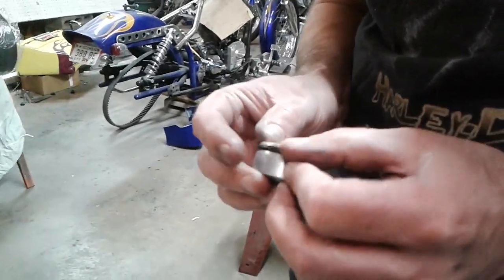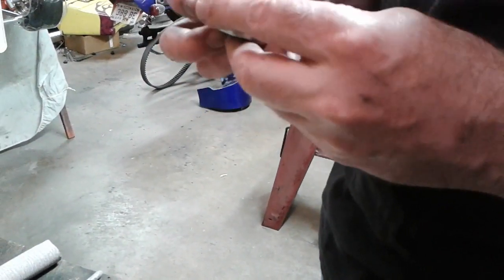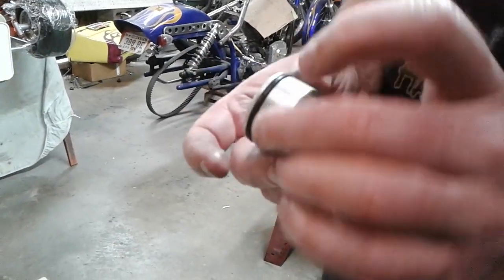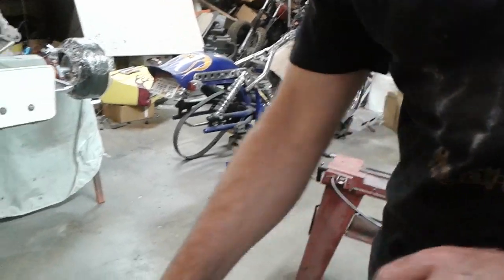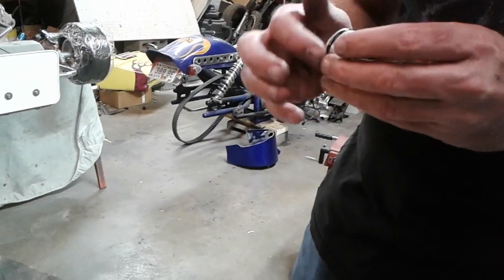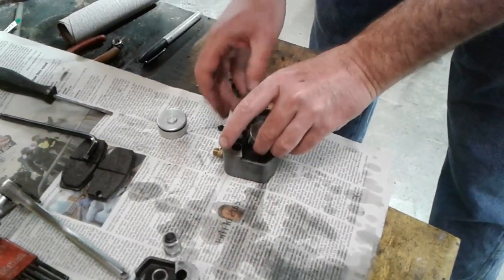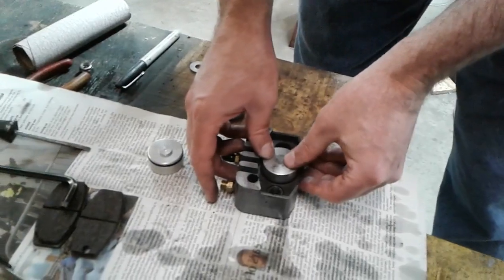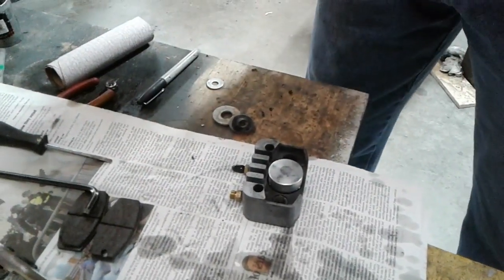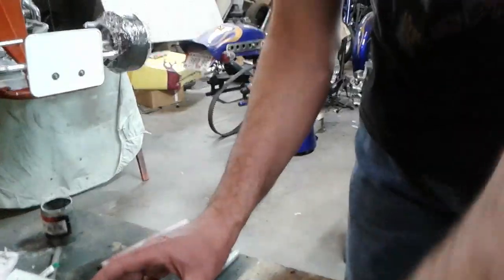He's putting the O-ring on the brake piston now — get those two O-rings on. Get a little DOT 5 on your fingers and wipe that down with DOT 5 around that O-ring so it's got a little DOT 5 on it. Wipe the inside of that bore down and put a little DOT 5 on that bore. When you put the piston in, make sure you put the right side down — the side with the little step on it goes down with the O-ring. Don't put it any other way.